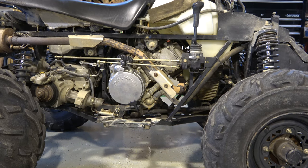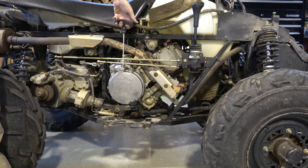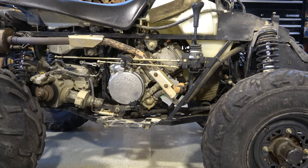I would call that a success. There's a little bit of slack in the pull initially before it engages, before that arm springs out and grabs — which is good, you're not bending over as much when you pull. Plenty of stroke, fits nice and tight. I don't know that I'm going to need this much hopefully — it's just nice to have as a backup if you have a bad battery situation. Wanted to seal up that hole and everything — wasn't that big of a deal. The pull start mechanism is similar on many different things: chainsaws, lawnmowers, snow blowers.